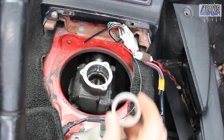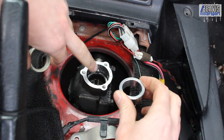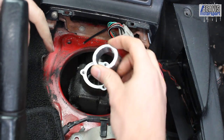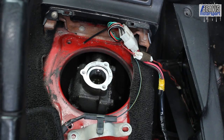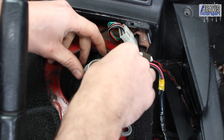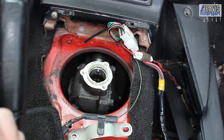The first thing you need to install is your turret spacer. If you've got an NA model you'll have one notch to line up with the single nugget here; if you've got the NB model you'll have two nuggets and two notches. Lower this in place and it will seat where the original plastic bushing went. On top of this we then place the plastic bushing we removed earlier, with the wave washer — note the little cutout goes towards the back of the vehicle.